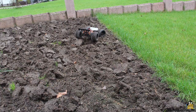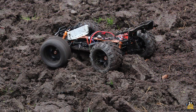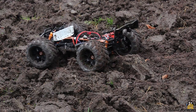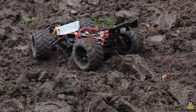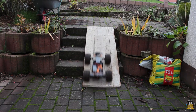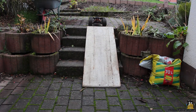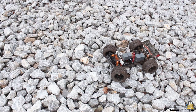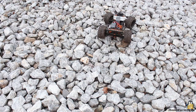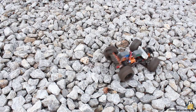That's getting even more tricky in extremely rough terrain, and another issue in low speed driving is caused by the differentials. Whenever a wheel loses contact with the ground, most of the drive energy is forwarded to the wheel that's in the air. The Zombie is made for fast driving, and that's where differentials are needed to give the car better stability. A braking system is also needed to stop the car from rolling downhill whenever the motor is disabled. You can solve those problems either mechanically or by adding sensors and electronics. In the first scenario you can simply lock the differentials mechanically and add a larger gear ratio to the drive. The latter case is challenging — you will need to sense the angular velocity of the wheels and activate mechanical brake systems.